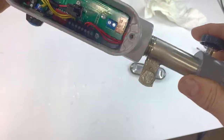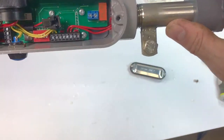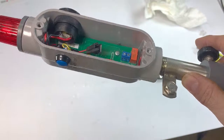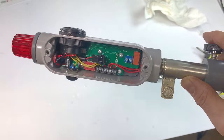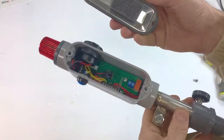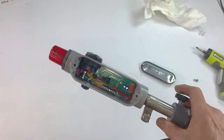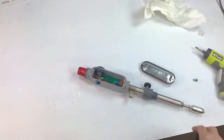Down here is the lowest corner — I don't know if we can make it out from the lighting, but it is completely dry on the inside. So that is an IP65 test. That is probably a little bit more severe than IP65 because it is done from a distance of about less than a meter, as you saw in the earlier video.